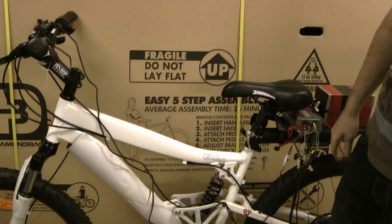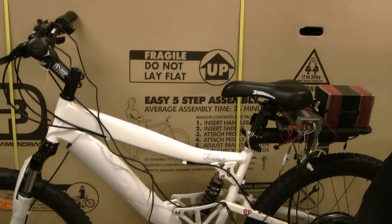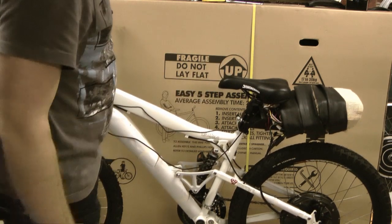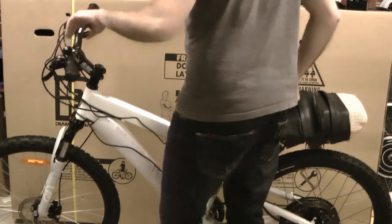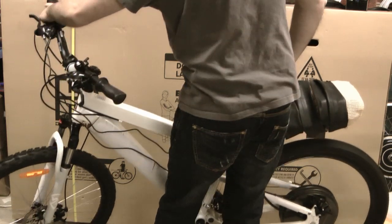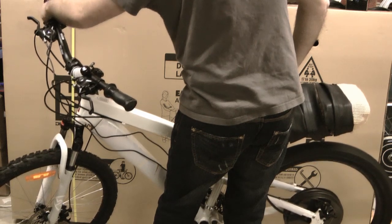As far as the actual kit installation goes, that's it. I've just strapped the battery and controller down with an inner tube for a quick test — it's a good idea to test the kit once it's bolted together before you tidy all your wiring, just in case there's a plug you haven't plugged in properly or a loose wire. Everything's connected and turned on now, so if we lift up the back wheel and twist the throttle — that's low speed mode, middle speed, and top speed.